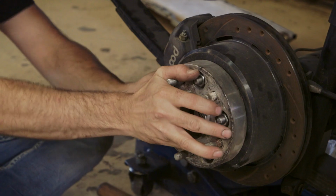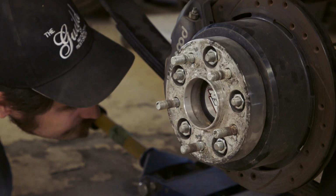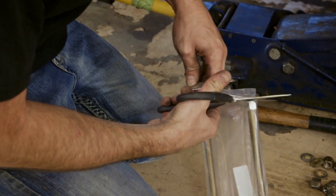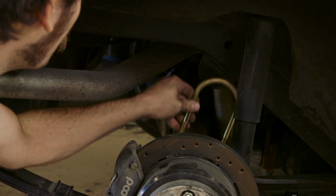Potentially, a downside could be that you run into a clearance issue if you're going over large speed bumps, but really, it's going to improve the handling of the car by lowering the center of gravity. Nice. And longer U-bolts to accommodate the extra distance here. I imagine these will be quite a bit too long, so I'll have to cut them once we're happy with the ride height.